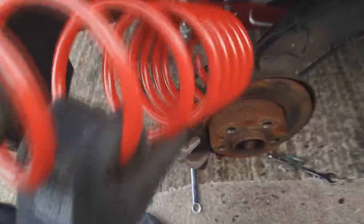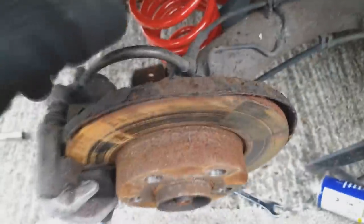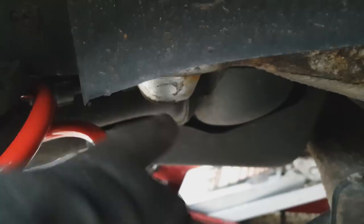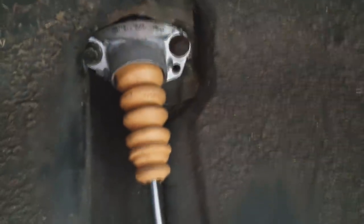I'm going to try and put the spring in first — maybe with one hand. There's a cup built into the mount — I need to make sure the spring sits right in that cup. Then this rubber bit seats onto the damper. I'll put the spring in and come back. The spring is now sat in its cup, sat in the top cup, bolted in at the bottom and bolted up at the top. I just need to slide the damper assembly back up onto the cup with two hands.